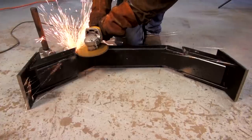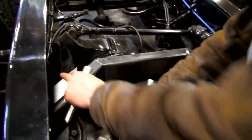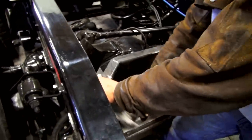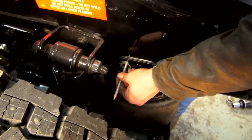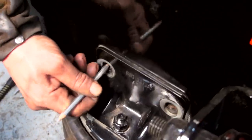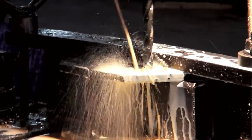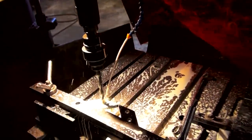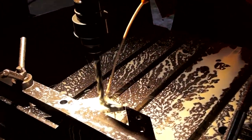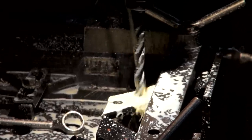The crossmember you'll receive is tacked, so you'll have to cut your tacks first and trim a certain length off — probably around two inches depending on your truck. Next we're transferring the layout onto the crossmember ends so we can drill these. Typically we'll use an oversized 5/8 drill, which will give you a little room in case there's an error in your drilling.